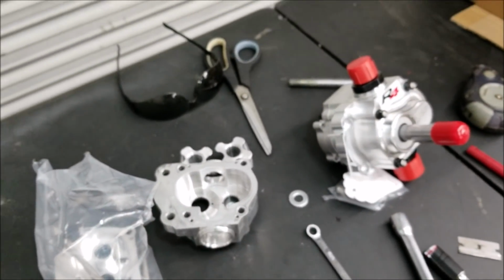So what I've decided to do is, rather than, I could change the pump out to a G-rotor design, which is also a very efficient design, but a G-rotor pump runs a little bit hotter, it puts more heat into the oil, and they're also made of steel, brass, so they're also more reliable, they're more durable, they can last longer. But again, they're not quite as heat efficient. They put out more heat energy, and they're also heavier. And you also got to get a larger one to make the same amount of flow and pressure.